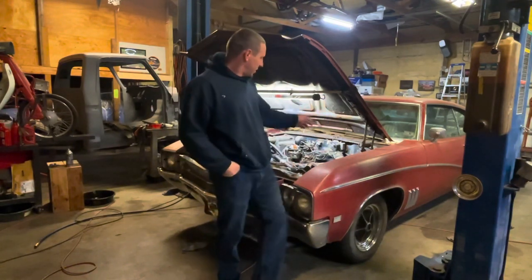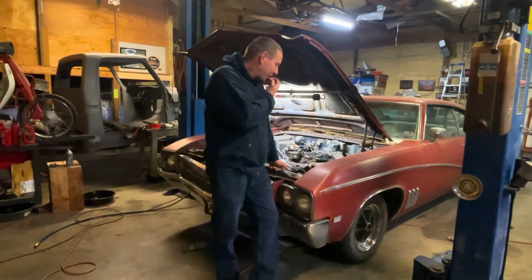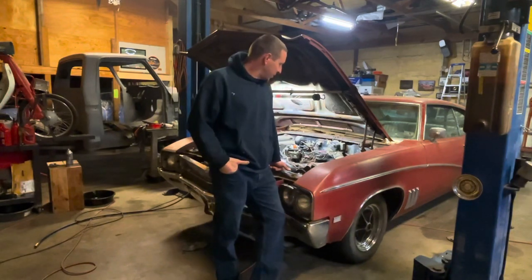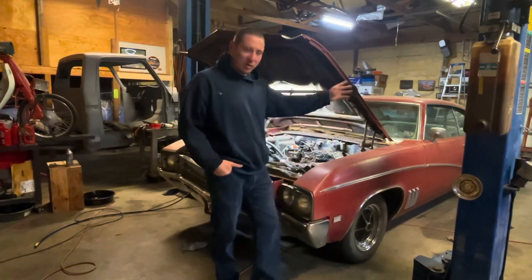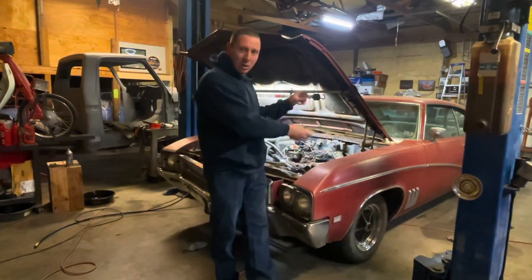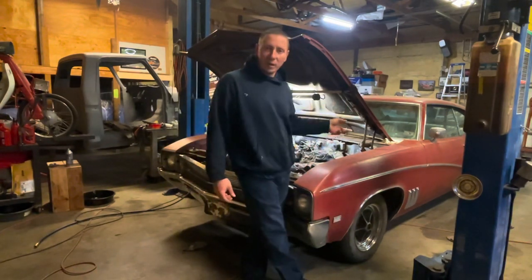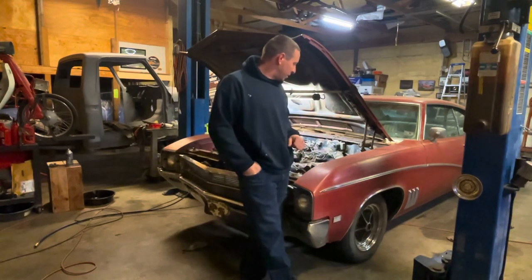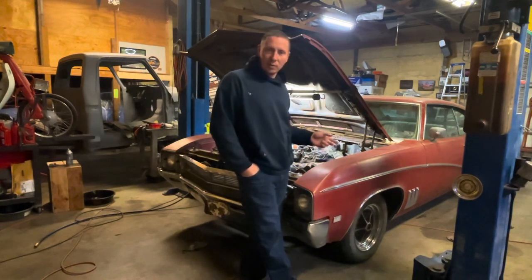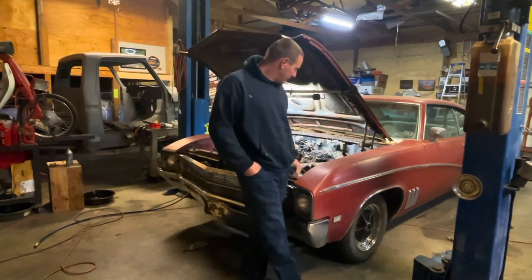Today, we're going to start by popping that master cylinder off there. Probably doesn't have any fluid in it, and that'll hopefully start letting anything that's left in them lines drain downhill. And I'll pop off the little drums and the other drum and then replace all flexible lines, hoses, I guess you call them. Got new wheel cylinders, new front brake shoes. Then I've got hardware kits.